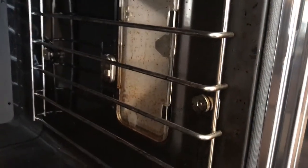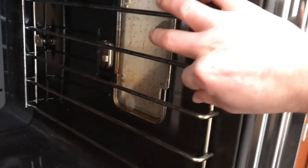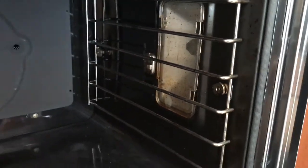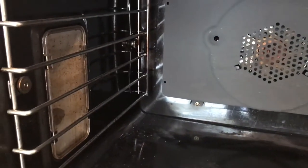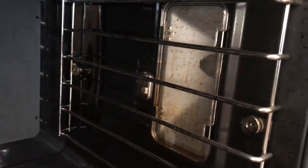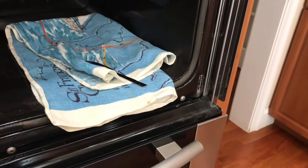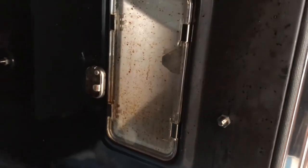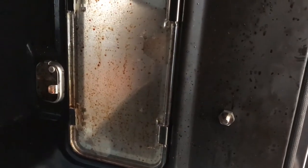The lights are gonna be behind the runner, so the first thing you have to do is these thumb screws here. You'll have to loosen them up and then remove the runners so that you can get to the glass protection behind. With the door removed, I've got more access to removing the runners and to actually get to the light.